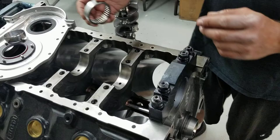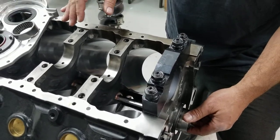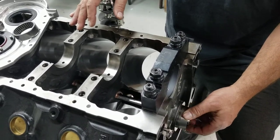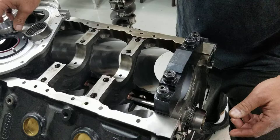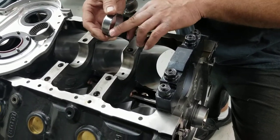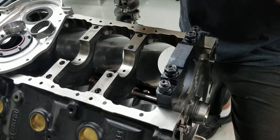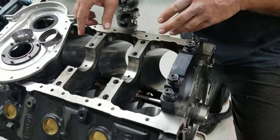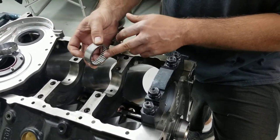The reason why we do this is twofold. One, it frees up friction — there's no doubt that it adds a little bit of power and some torque. But what it also does is it increases mechanical reliability and reduces any chance of bearing seizure or movement of the bearing material from the excessive loads placed down on the lifters, onto the camshaft, and then onto the five main journals.